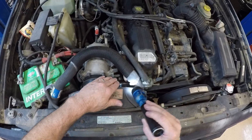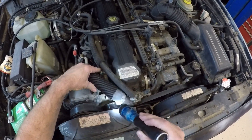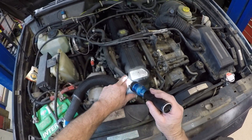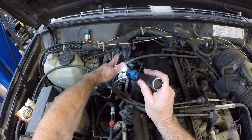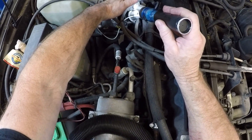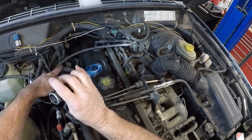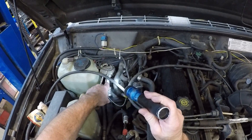On the other side of my water pump, I also have a return hose right here coming from my heater. So coolant will be forced out here — the hot coolant will come through this hose, my heater hose, to my heater control valve. My heater control valve is controlled by vacuum, so this vacuum starts coming from the engine, goes through the control and the dash, and comes back here.